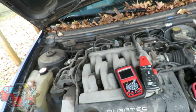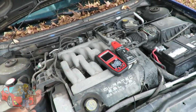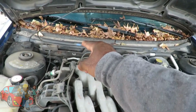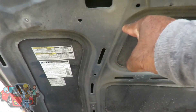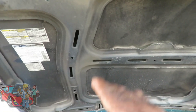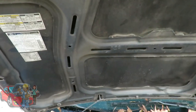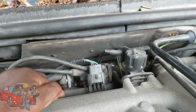The first thing we do on this Cougar — your vehicle might be different. When the computer sends a signal to the coil, it ramps up voltage. It's going to look like a mountain — ramp it up and then shut it down. If there's a problem in there, we won't get that ramp or we'll get a bad signal. So what we're going to do is tie into the system.